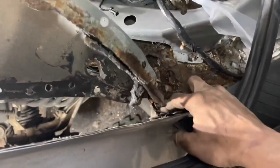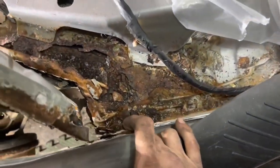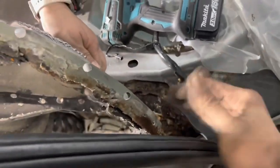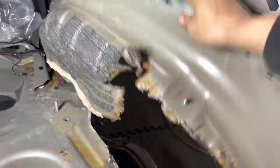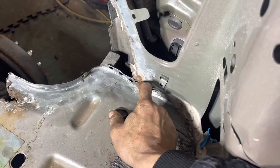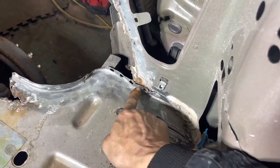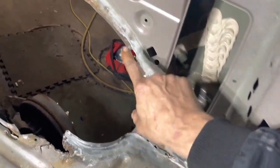Sometimes it's simpler to cut it off down here and then use the spot weld chisel to remove the last remaining portion, but you can usually wiggle it back and forth and break it free. With everything drilled out you can remove it from between the panels. You can see how it was lipped in between this panel and this panel — when you drill through the ones down here you have to drill through two different panels, whereas up top you only drill through the first panel.